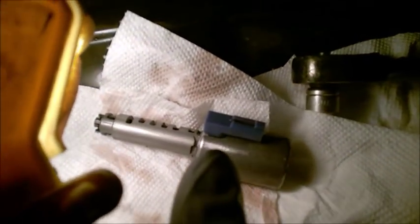Notice how the solenoids just go pretty much all the way in, all of them. If you wonder how to place them in there, the lower bracket is all in place, but the solenoid definitely goes almost all the way. If you look at the one I pulled from there, they have a groove here, so that's the groove where the bracket is sliding on. Because of that groove, they can only stay in one position once you secure them with the bracket, once you have the bracket against the valve body and the bolt properly secured on the bracket. So that's pretty much how they go in there.